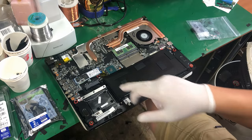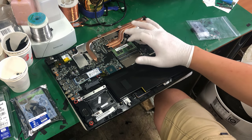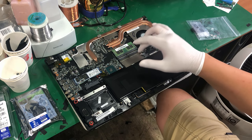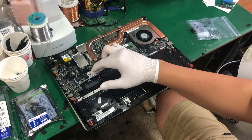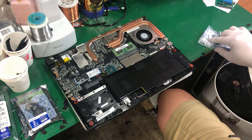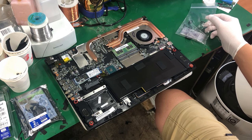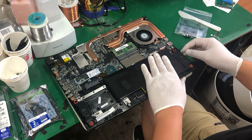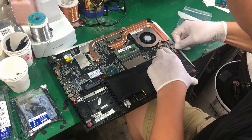From here you can see the layout. There's an M.2 slot — this laptop comes with a 128 gigabyte SSD by default in Korea. There are two memory slots; one is populated with an 8 gig Kingston stick, and there's an upgrade bay for a second slot. Today we're only upgrading the M.2 SSD and adding the two terabyte hard drive in the dedicated 2.5 inch bay. Since this is a relatively new computer it's very clean inside. First, to be safe, we'll unplug the battery so a loose screw can't short out the motherboard.